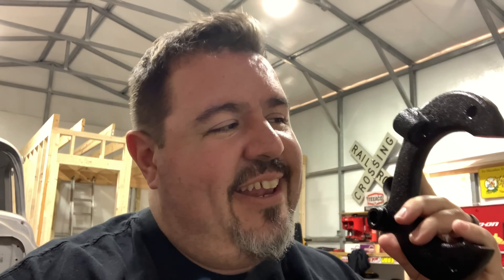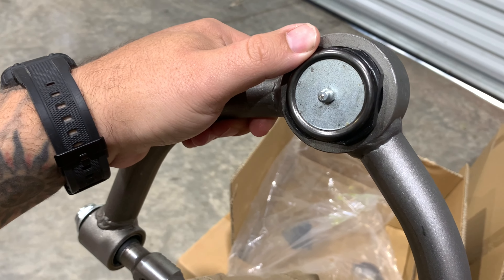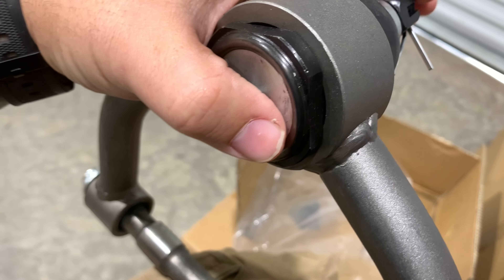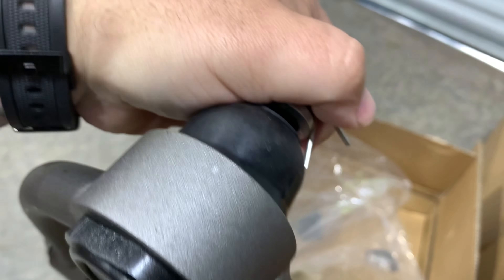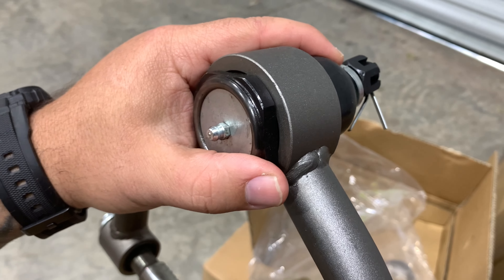Take a closer look — it's just a really nice heavy duty piece, and it looks like we have grade eight hardware applied, which is always nice. Let's take a look at the upper control arms. They are super beefy — they're one-inch tubes, really stout. I like that there's a screw-in ball joint; that's a big deal to me. The ball joint itself is not crappy — they're really, really stout. If you play with some other control arms, they kind of wobble around and feel almost like a toy. These are good quality ball joints. I'm very happy with that.